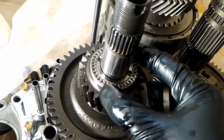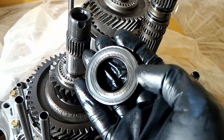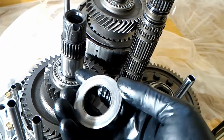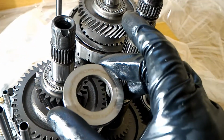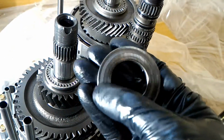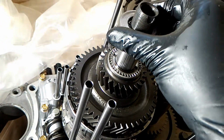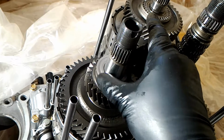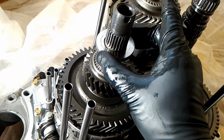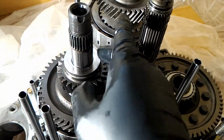Okay, so I put a needle bearing in here, and the one that's got more lubrication is the side on the bottom. And you can see the wear on this washer, which is the race for the top of that needle bearing, this was what was sitting on here. But what I'm thinking is, why don't I just flip this over? Because maybe this side's less worn or something. This side feels smoother for sure. But I'm going to put this on here. And it spins okay. Let's see. That might spin even better. I'll decide which side I want to put that washer on.